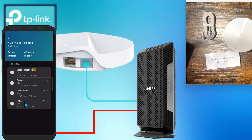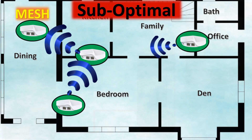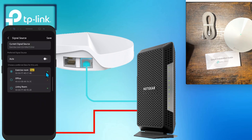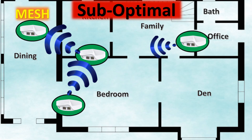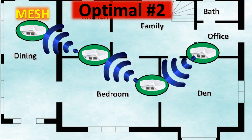There is one thing to be aware of. If you look at the unit in the garage, you can see the signal is really weak. No matter how many units you have, the one farthest away from another unit is going to have a very weak signal. Under connection preference, it's normally best to leave it on auto. But if you think one unit is closer to the one with the weakest signal, you could change it from auto. If a unit has a weak signal, you might move it closer to another unit and select connecting the two together to improve signal performance.